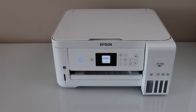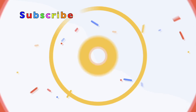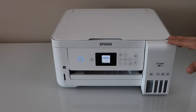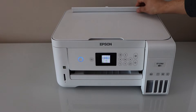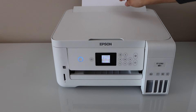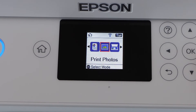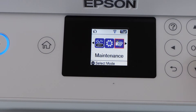In this video I'm going to show you how to fix an Epson EcoTank ET printer that is printing blank pages. The first step is easy - we just have to do it using the display panel. Load A4 or letter size paper on the rear paper tray, then go to the printer display panel and navigate to maintenance, which you can access through settings or directly.